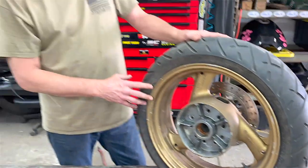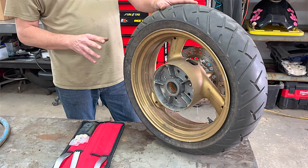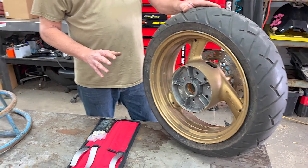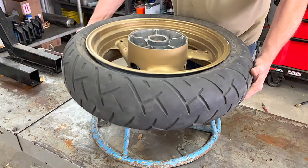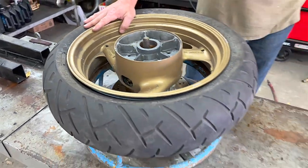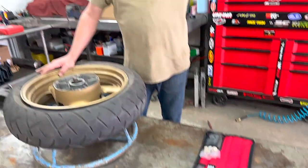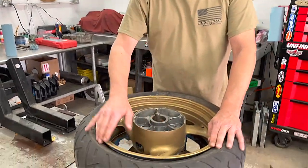We're now ready to remove the tire, or if we needed to just remove one side of the tire to do a patch or reinstall a tube, that kind of thing. Safety-wise, this can be a little bit of a bear — you can get a hand with it — and you need a really good way of holding this wheel down. This is just a manual type ring. These tire irons can be used like this, or they can be used on the pneumatic machine also. As you can see, we've got the tire bead broke down.